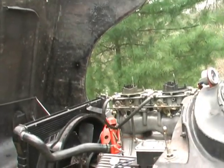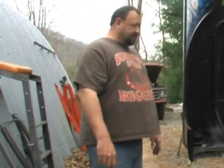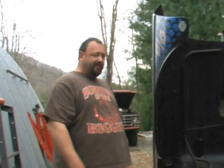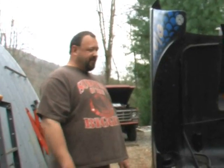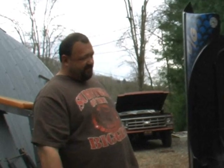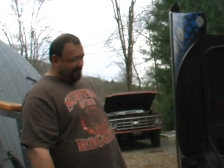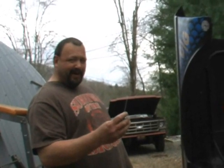It's in there. Don't know how it'll run - if it's faster than the other motor, I don't know. If it's stronger than the other motor I have no idea, but it sounds pretty damn healthy. It'll turn further than the other motor - it spins up a lot easier than the last one. About 6,200 is about all my other one wanted, and that one just gets up there without half of it. So we'll probably put the rev limiter at seven thousand. We'll just have to drive it and see.